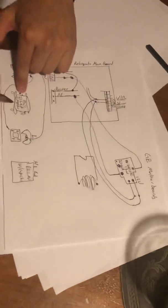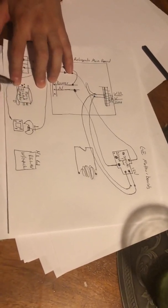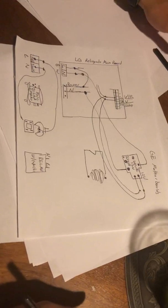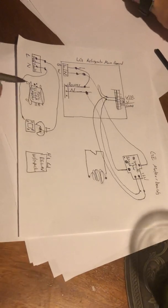For the relays, you're going to need the 115-volt compressor. It has to be a 115 VAC compressor with 21 LRA. The brand I recommend is Embraco — the Embraco is not going to give you any trouble at all. I give a one-year warranty on my units, and it would be very rare to have a problem. If I didn't put an Embraco compressor, I'd get the refrigerator back. Since then I've just used Embracos and they work super, super good.